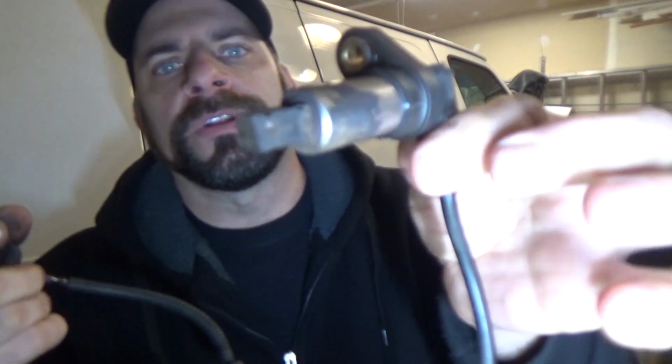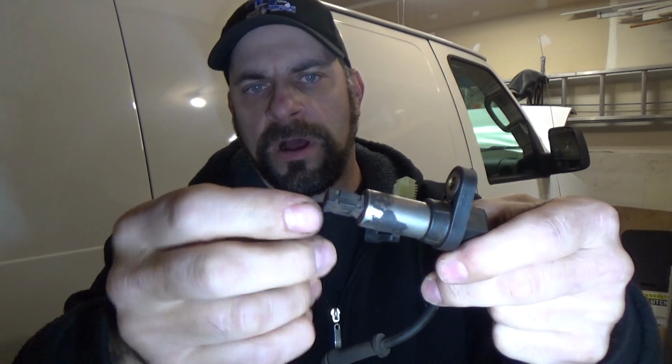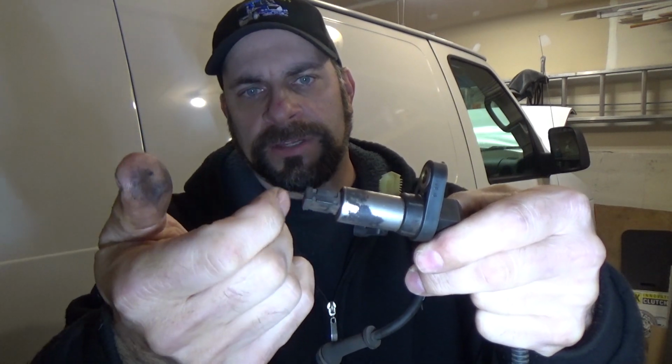Okay, so if you're testing a variable reluctance passive wheel speed sensor, I hope this video has helped you out. Here's the one that we pulled out. There we go. And some things that you probably should look for before you just condemn it. Obviously the testing is the best part. If you've got the fancy scan tool, that's really helpful. But some things that can go wrong: you can get debris built up on the tip here on the sensor. This could get damaged. There's a coil in here that could go open or get shorted out.